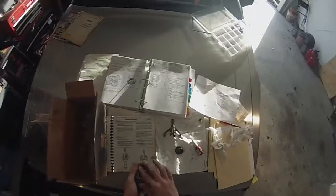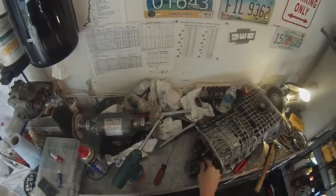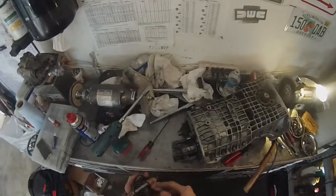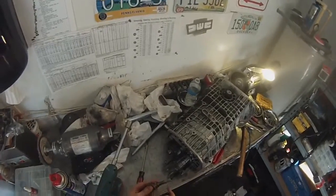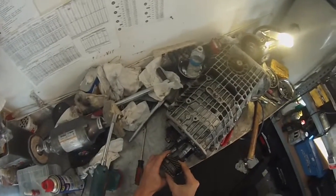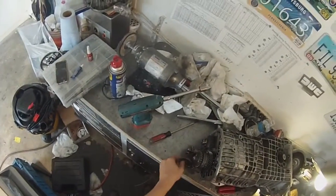I'm going to stack this all back together because I think it's best to install the whole fifth gear assembly as a whole. Put the needle rollers and sleeve back in the middle. This is your fifth gear selector fork — you have to put this on the fifth gear before you can put it on. Also, before you put any of the assembly on, you need this big plate washer; it goes on the outside of your angular contact bearing. Make sure the shaft of your fork goes into this hole here as you install it, then install it all together.